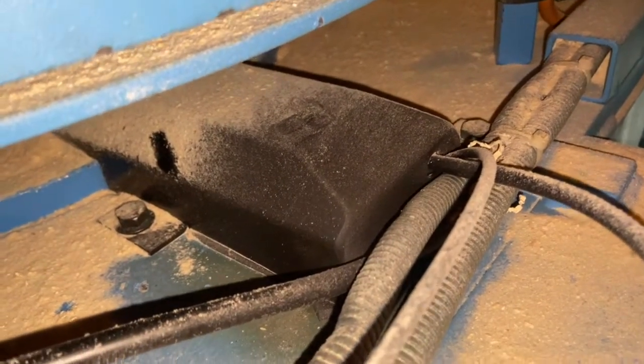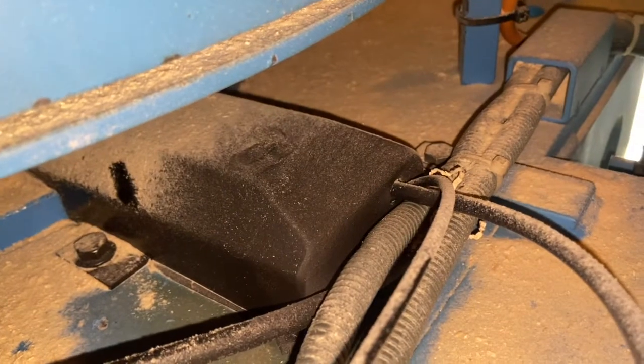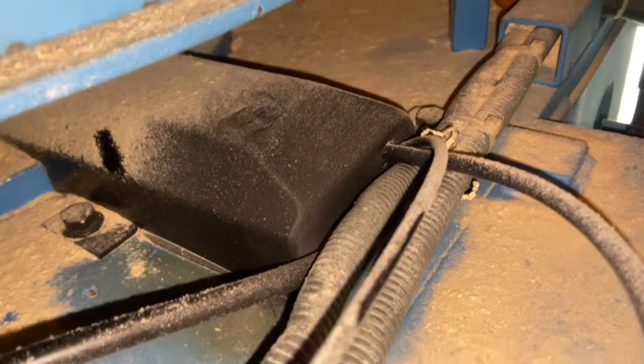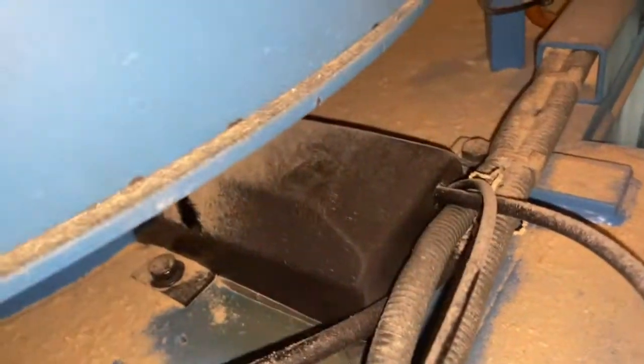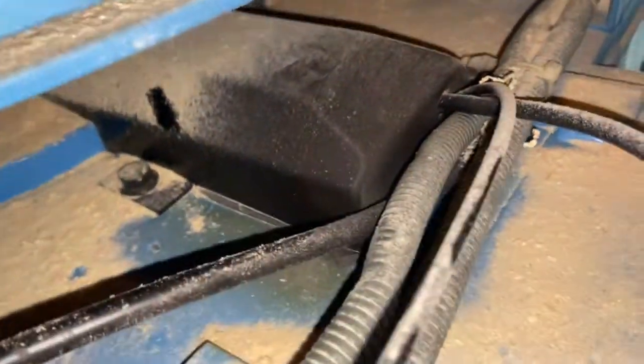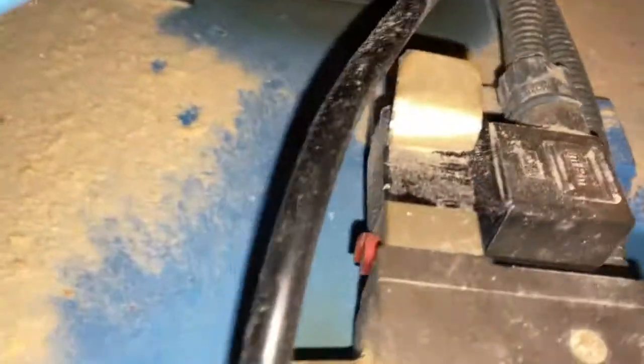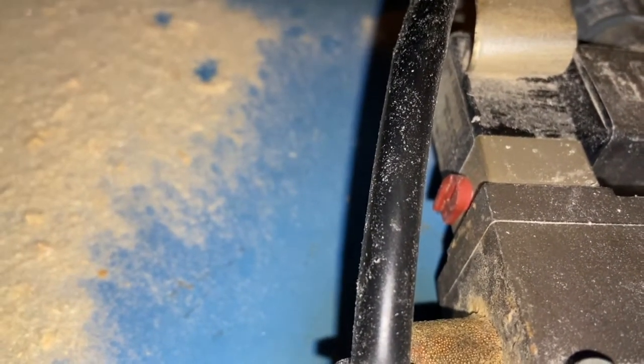You just want to adjust that screw and have an assistant pull a piece of paper through there until the air gap is correct. You can also use a 0.1 millimeter feeler gauge if you have one available. We say a piece of paper because that's what everybody normally has handy, but the actual spec for the air gap is 0.1 millimeters.